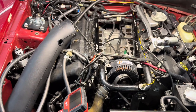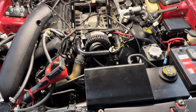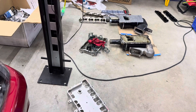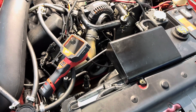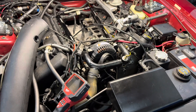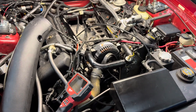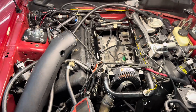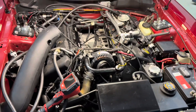I'll post another video when I start getting stuff back together. I still don't know what I'm doing for tuning yet — at idle it's not going to be a whole lot different since the car is already tuned for that blower. I also have a 10-inch lower pulley to go on. I'll probably get the car running first and then do that last swap — the 10 lower — and then at least get it running so I can drive it onto a trailer and get it tuned. I'll update everyone here hopefully soon.